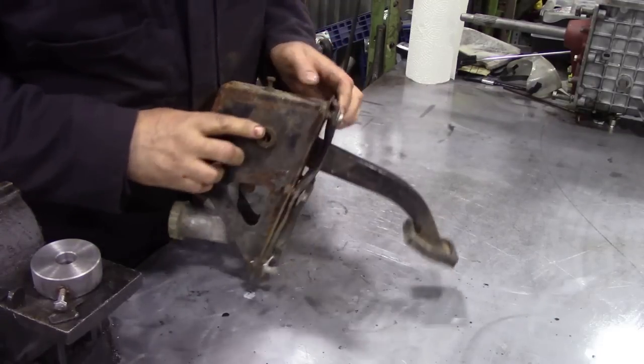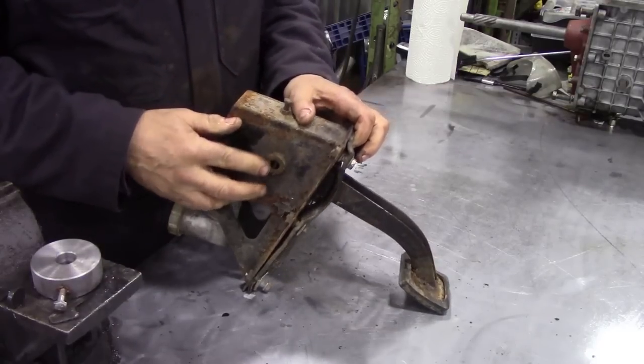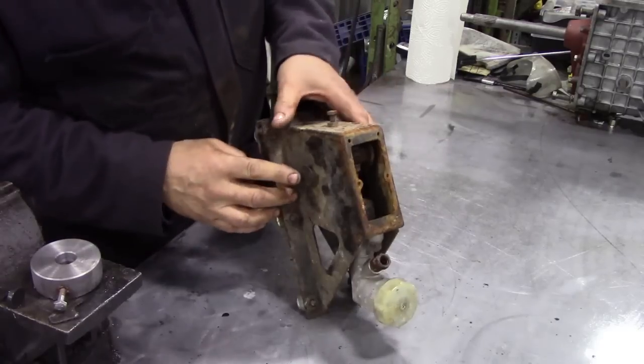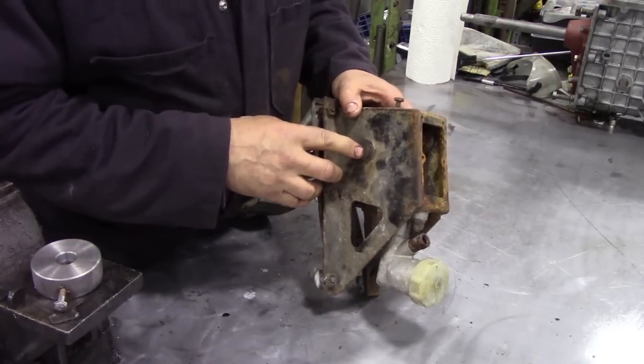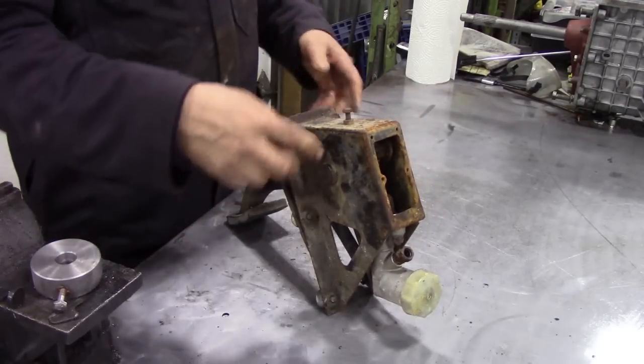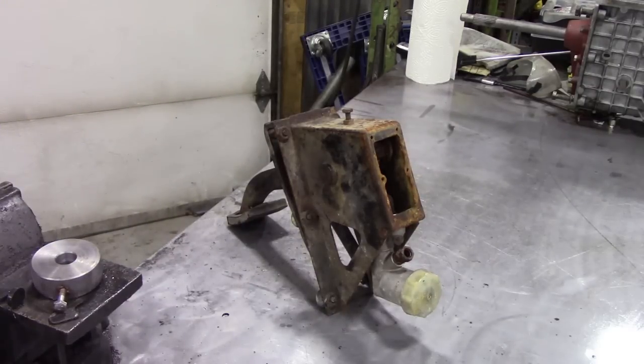What I'll do is take this pin out of here and strip it down 100% and get some oil or grease onto that bushing. Just a little thing — some of the old vehicles used to have a grease point on here. That was brilliant. What forward thinking was that? You could just give them a bit of a grease. Now you can't. Well, there's progress for you.